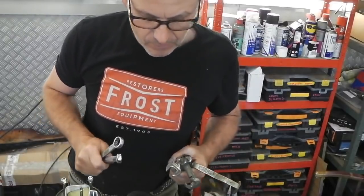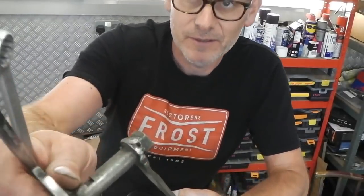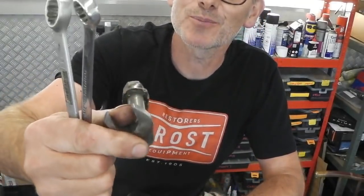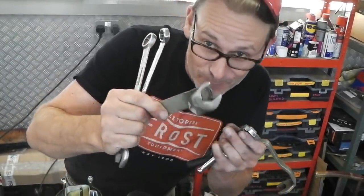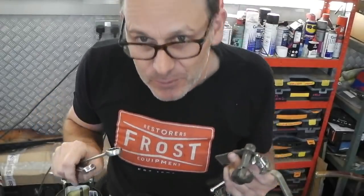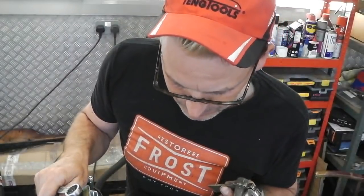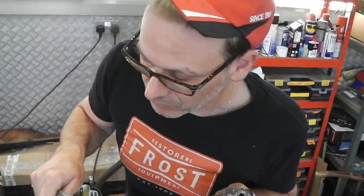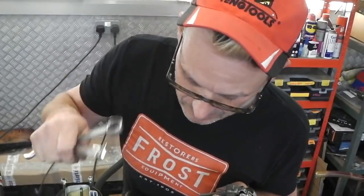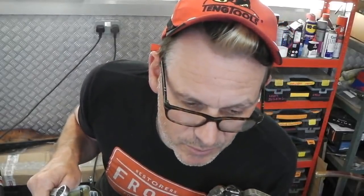Okay. This one, as I said, was homemade. An earlier one I did out of an old bit of a gear selector, chopped up spanner, bit of nasty welding. But we did it and it got us through the early days. Car boot sales, car shows and stuff, slowly accumulate your bits, is what I did until I knew what I was doing. Right, it's 0.2 and 0.25mm on your feeler gauges, so we're going to do that now. Is it inlet 0.2, exhaust 0.25?